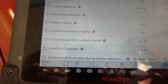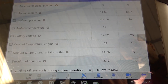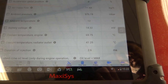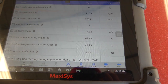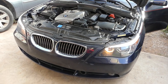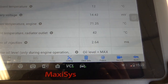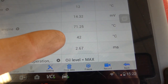As you can see, we're checking coolant temperature - engine is at 69 degrees Celsius. It'll probably go around 90 Celsius, so we're just going to keep an eye on that and make sure it doesn't go over about 97. Usually that's where the fan kicks in - around 94 to 97 - and we want to make sure the thermostat opens. We'll let it run; it's cold today so we'll probably do 30 minutes. You can also check the radiator outlet temperature - it's showing 42 degrees, which means the thermostat hasn't opened yet.